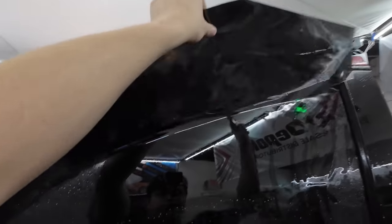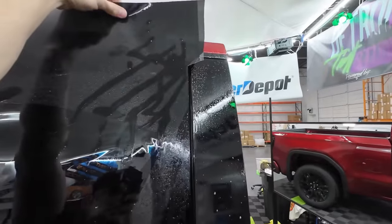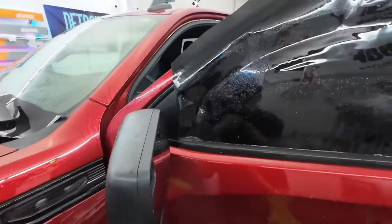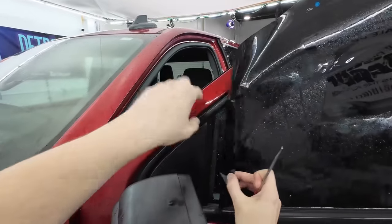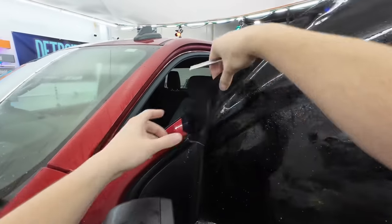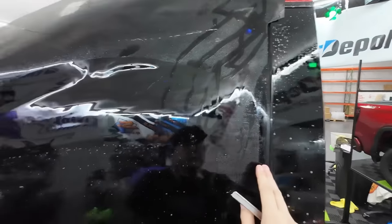Then we're going to loosen the film back up, slide it over to the right — basically over the entire width of this gasket here, still lining up the bottom. That just helps guide it so it lines up perfectly straight. Then go about an inch down from that edge, right in between the seal and the glass, tear away. Then drag it back about half as much so we have about an eighth-inch overlap on each side.